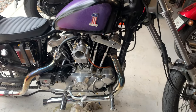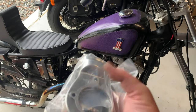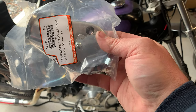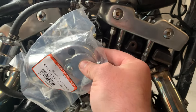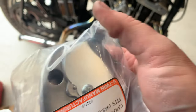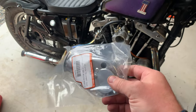I yanked the other breather off and I picked up this cool little thing. This is one for the old-school original Linkert — except this one fits an S&S. It says TT Racing. I don't even call it an air cleaner, it's just a snoot — an air intake snoot — so there's no filter in here at all, but it's really neat looking. It's this tiny little piece, so it'll be nice and small. It's just something different, and it has this little flap here for you to move down. I'm sure some of the old-school guys could tell me exactly what it was for. I assume since this was some of the racing stuff, it was probably to squirt some starter fluid or something in there.